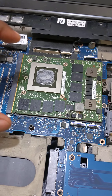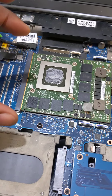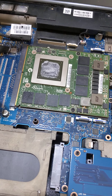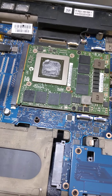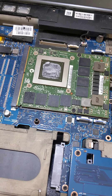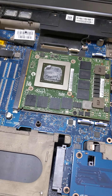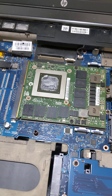This is the GPU. It's in what's called MXM 3.0b — as in boy — format. So if you want to replace your GPU, you'd have to get one that conforms to that format and it'll slide right in here into this PCI Express fitting. Right here is a Quadro 3100M — that's a really powerful graphics chip for doing production.